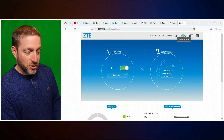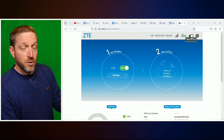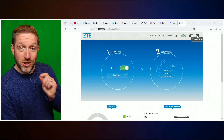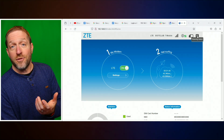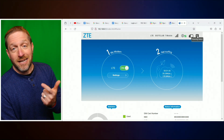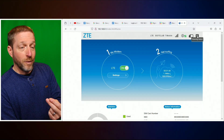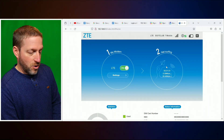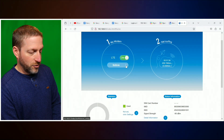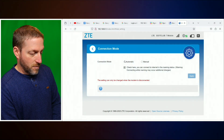It tells me my connection status is green. It tells me there's no SIM — well, it's a valid SIM card, but there's no separate micro SD card there. And it says I'm roaming, which is key because sometimes if you use a third-party carrier that is not T-Mobile, AT&T, or Verizon in the US, then you'll have to select roaming in order for it to get data. It tells me right here what my data rate is. And this right here is what you're going to be looking to do — you go into your settings, your connection mode, set to automatic.